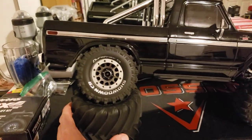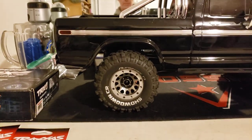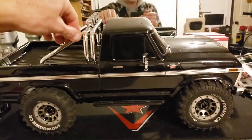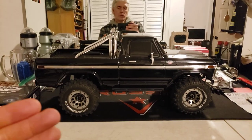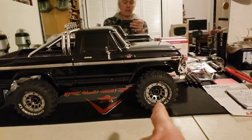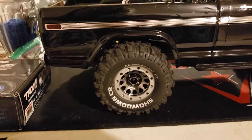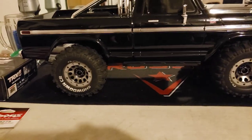I got the tire centered — we are about 100% in the center of that wheel well. The crazy part is, when you roll the body, it tracks with the links, the four-link suspension. Whatever side you're rolling towards, it rolls forward to the front of the fender well. When the front rolls to the back, the back rolls to the front. With it squashed all the way down, I am centered. I'm exactly where I want to be.